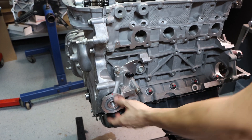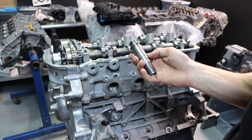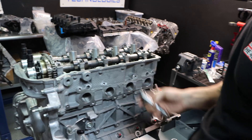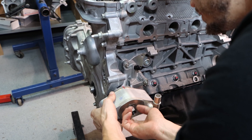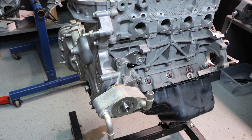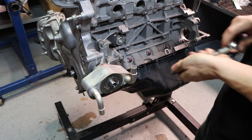I marked this here just to get my alignment good. Make sure this does have an O-ring — just so you don't miss it from the factory. This can only go on one way and it gives you just a little bit of room. This particular oil filter adapter tube does not use O-rings. I believe it's a 14 millimeter hex — and yes, it is a 14 millimeter hex. Just snug this up.